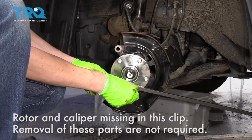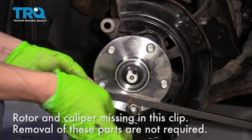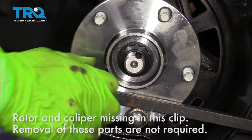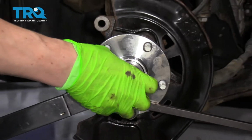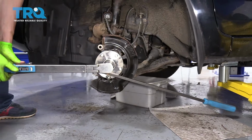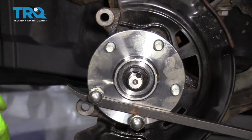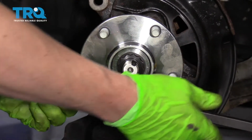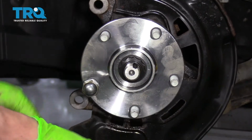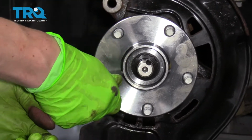You can do it just like this. I like to put a couple of lug nuts on to kind of hold the pry bar in place. And then as you turn this, it's going to put the pry bar down on the ground, and then you can torque it to the right torque. And then, of course, you can remove your pry bar. Just like that. It's an easy way to do this without a friend.